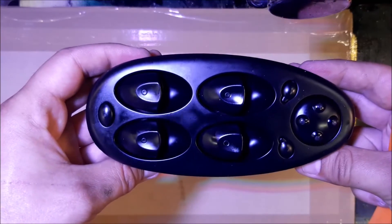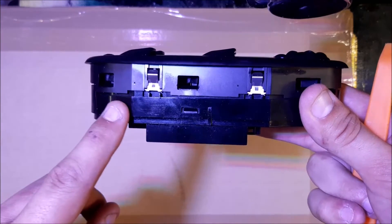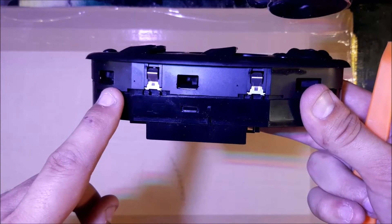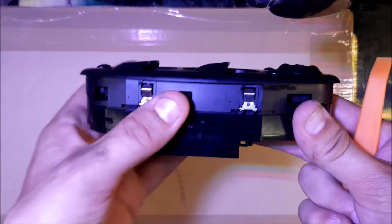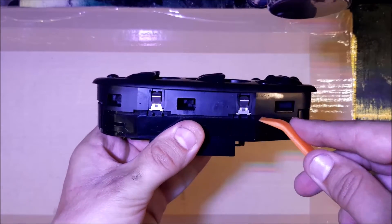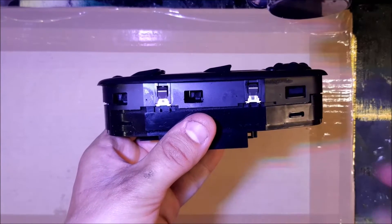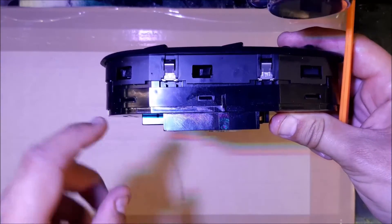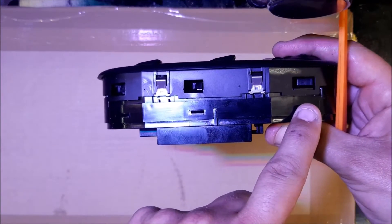Right, so we're now in the workshop. As you can see, we've got it out and it comes in two halves — there's the top half and the bottom half. To get to the circuitry, technically you don't need to take the top half off, but it does let you give it a good clean. It's held by little plastic clips, so it's a case of simply getting your plastic trim tool in and gently levering all the way around. I'll also undo the bottom part of the case, which is another series of plastic clips.